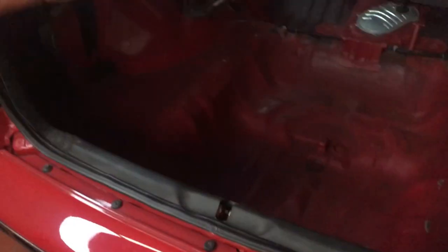So what I also want to explain to you guys is that when we do fit the battery rear kit, the battery is going to sit in this position. There is enough space for a bigger battery, so my friend did suggest when I do get the battery rear kit or the box that it comes in, I might go for a bigger one. The reason for that is, he mentioned that if I run a bigger battery, I would not have trouble with any earthing. If I run the smaller battery, I would then have to put additional earthing on the motor, I think from the body to the motor, the head, sorry, and then also one from the body to the gearbox, if I'm not mistaken. And there's another one he mentioned as well. You will just assist me with that. In the meanwhile, we are going to run the smaller battery.